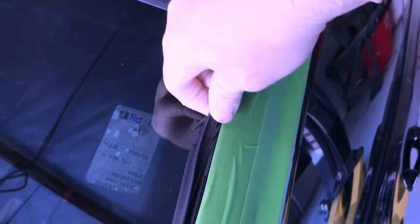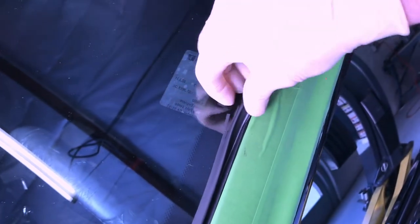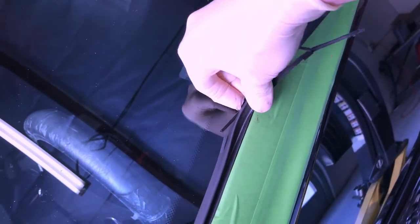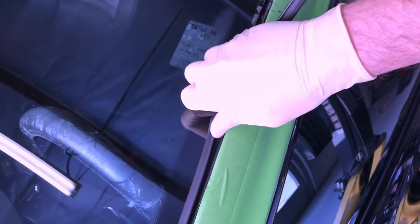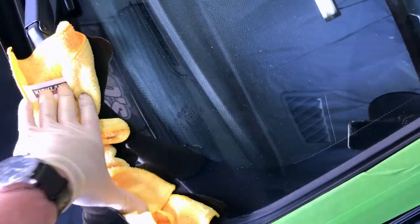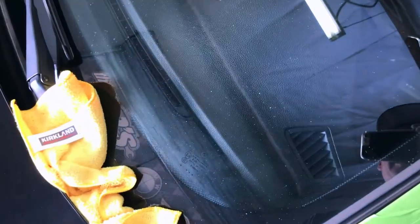Just like that, all the way down. Take it easy, take your time. The whole point is to preserve this windshield. Normally the seal goes on the outer perimeter of the windshield before it's laid down. You can't do this on all BMW windshields, but many of them you can, especially the 3 Series. As these little pieces start crumbling and falling down, they can get stuck in the drain and also start smearing. You want to collect that stuff — I usually like to put a rag here. Microfiber is perfect because afterwards it clings to the debris and any leftover stuff is easy to just wipe out.